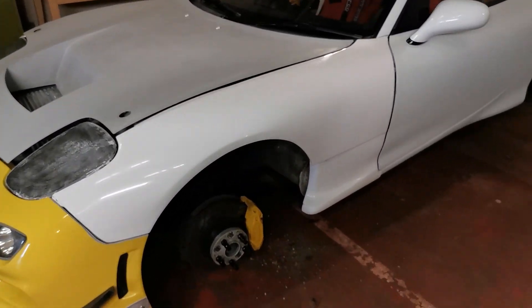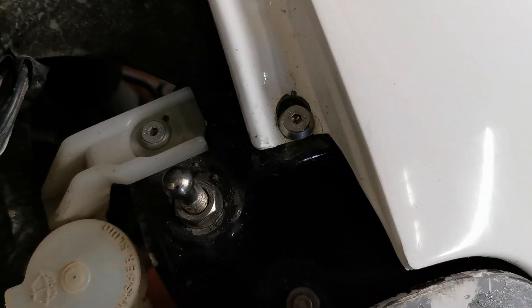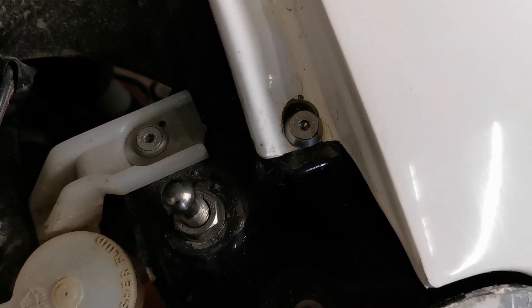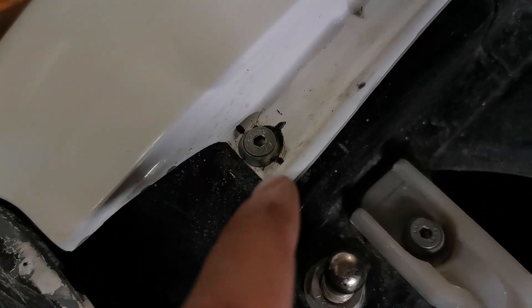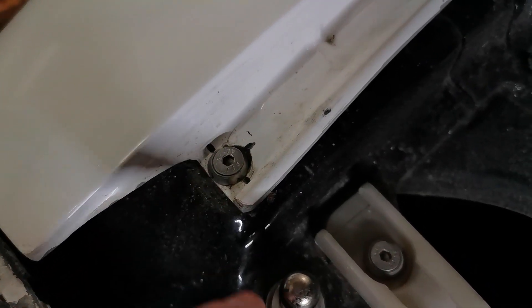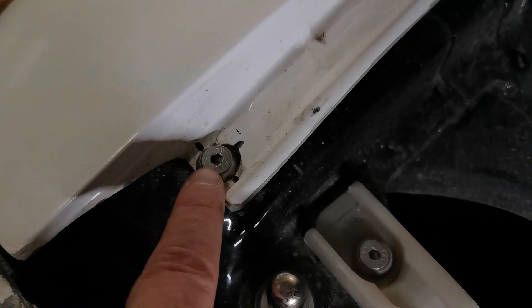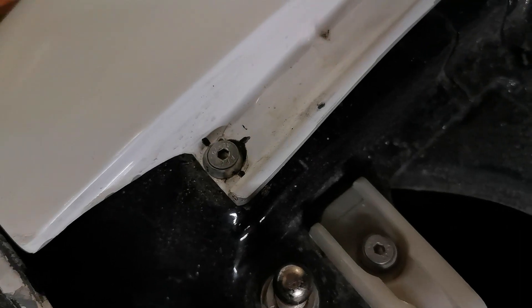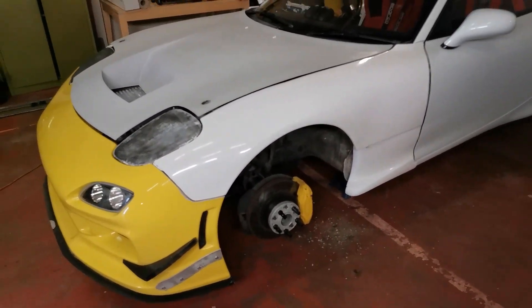Lining it up beforehand with the bolt holes — I've drilled the bolt hole to about 10 or 12mm, which allows me to move the panel around and get the gaps lined up. On this one, I've put an X on it. So I'll line all the bodywork up as best I can, put an X on, take the panels off, fill that hole with some fiberglass, and then drill it on that mark so it bolts on and off in the exact same place every time — otherwise we'll end up messing about lining panels up every time.